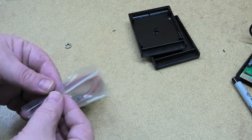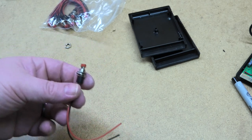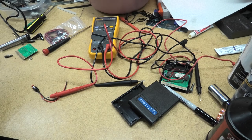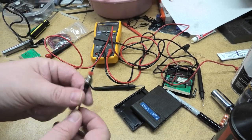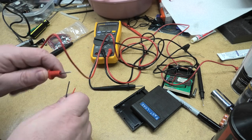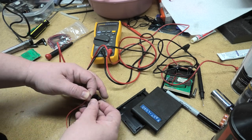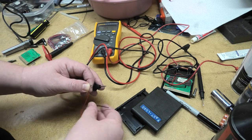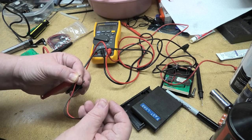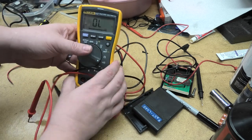I've switched to these now — I get them off Amazon, I'll put a link below. They're already pre-wired and ready to go, we just need to solder the tips in. Be sure to test the switch before you install it. I've done this before and the reset switch didn't work — it took me a while to figure out it was because the switch was bad. I use my multimeter set on continuity — this is a good switch.